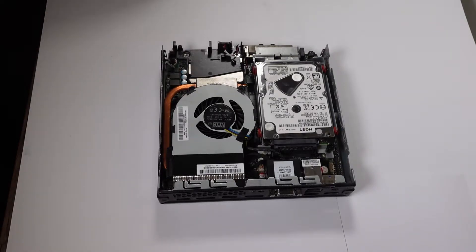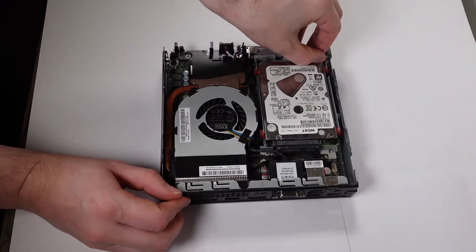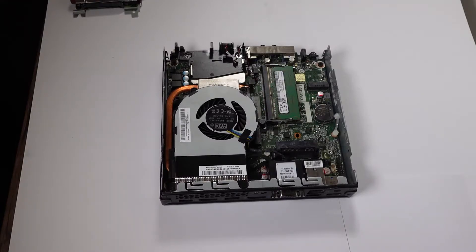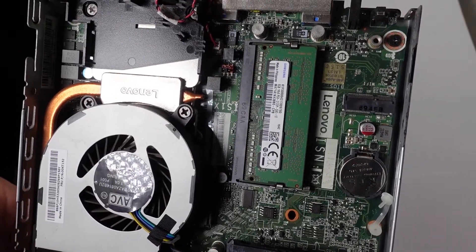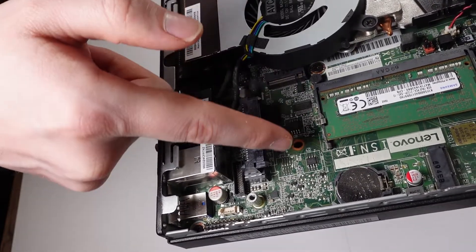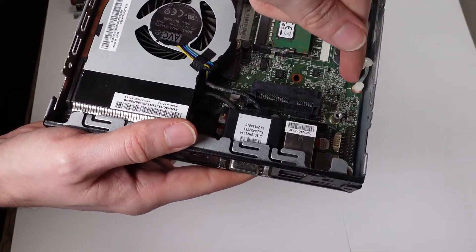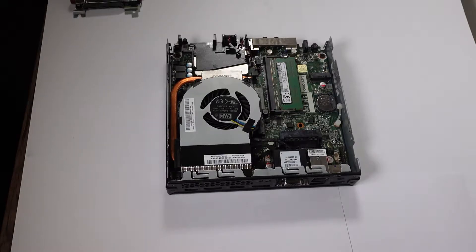Interestingly, this time we seem to have a thumb screw here. In terms of upgrades, this machine should be able to take 16GB of RAM, no problem — max of 32GB. I'm going to be installing 16GB; currently there's only 8GB. We have an empty slot for Wi-Fi, an M.2 slot, and down here, slightly hidden, another M.2 slot which can be configured in two ways. It has one of these plunger things for locking it into place. It can run SATA M.2 drives and NVMe, which is quite nice.